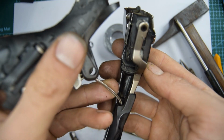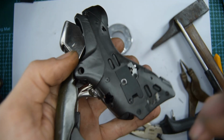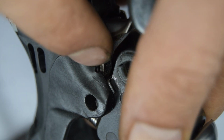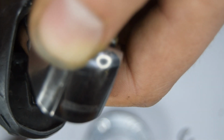For the finale, we're going to slip that back into the holder on the brake arm. And once you've done that, I'll zoom in. That tip of the spring is going to go into the hole right there. To get that in, I'd say the best way is to lower it down towards where the hole is going to be, without this arm coming out. And then after we can kind of slide it in. There you go, it's popped in. So I'm going to re-raise it up.